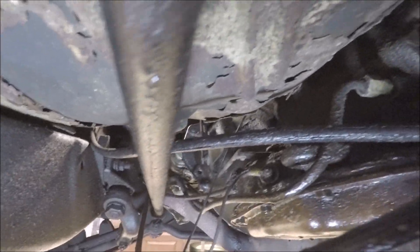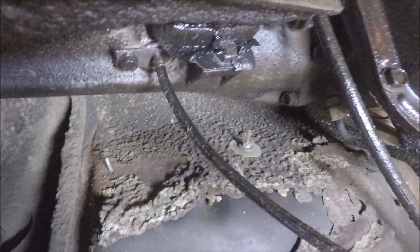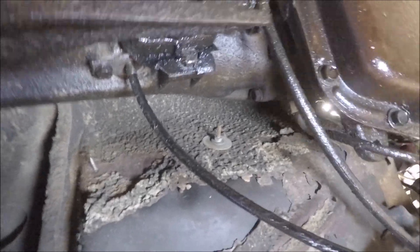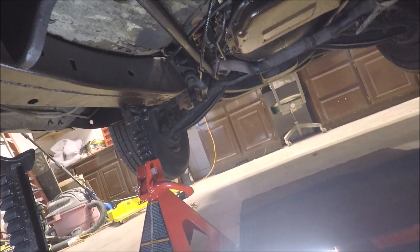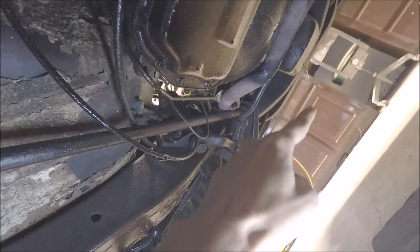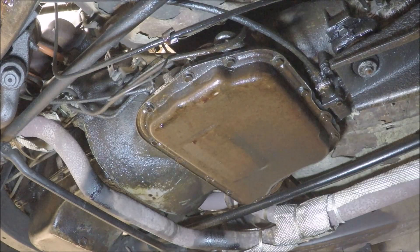You have the linkage side here and the speedometer cable right up there. I did remove the speedometer cable and the gear because I want to keep that for later — so the gear is not in place right now. I'll put a plug up there to stop the leaking since the speedometer doesn't work and is frozen up. Here are the cooler lines coming down — this one is absolutely mangled, bent in all sorts of shapes. Before removing the transmission I'm going to drain it a little and put the pan back on.